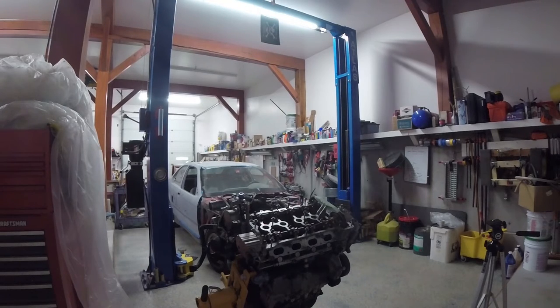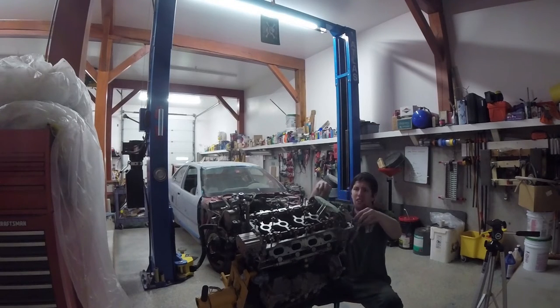You should never do your oil changes by the MINI interval — that interval at 15,000 miles is significantly too long for a turbo car. Those intervals should be about 7,500 miles on full synthetic oil at the most. I recommend shorter change intervals on this.